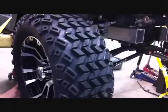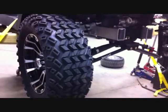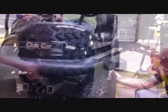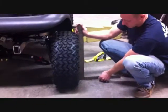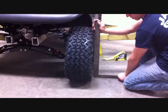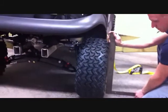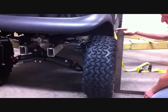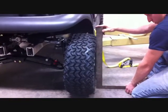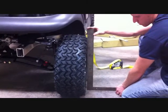Now install your wheels and tires, and drop the cart to the ground to check the camber. With somebody sitting in the middle of the car, run a square — we're out about a half inch at the bottom. We're going to shorten both the heim ends on the top, driver and passenger side, so that with weight on the car we're approximately a quarter inch out at the top.